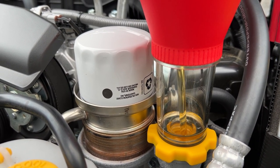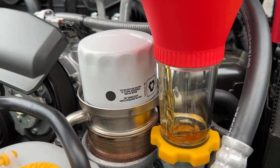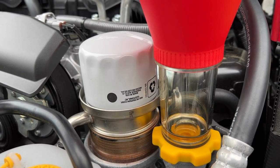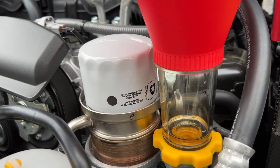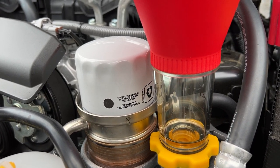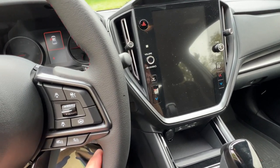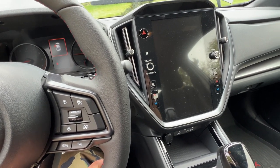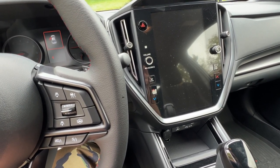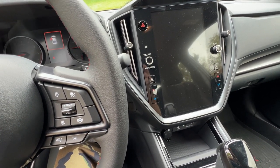I love the easy maintenance on this Subaru — everything is right on top: the oil filter, air filter, you just pop it open, no screwdriver needed, super easy. I'll stop and check it on flat ground. I've confirmed I've got oil on the stick, no drips. New oil filter installed, no drips from the Fumoto, and probably about four and a half quarts installed right now. I'm going to go put it on the flat driveway after I warm it up and check it again.